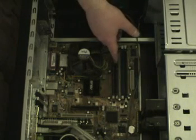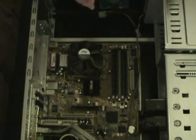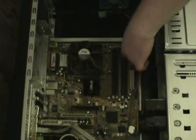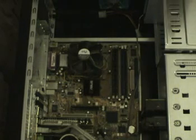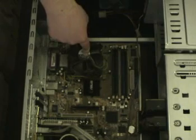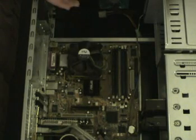This motherboard has slightly more space than regular RAM slots, so it can actually fit heat-sinked RAM. Some motherboards have RAM so close together that you can't fit heat-sinked RAM. There's also an open slot here, which means you're going to have good cooling on those sticks, while the outside ones get outside air cooling. If you get a vertical heat sink, you have to get something that's going to blow across the RAM for cooling. Just take a look at everything in the computer and think: is this going to work thermally?